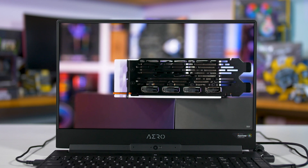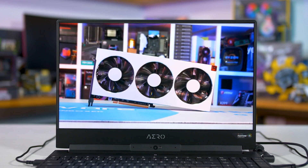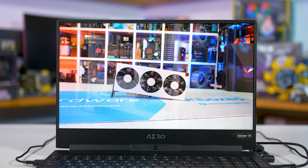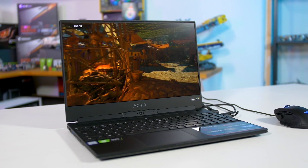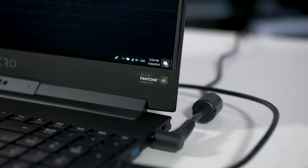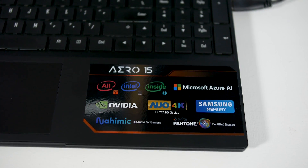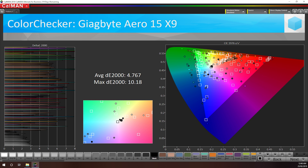My Aero 15 X9 review unit came with the 4K 60Hz IPS display option rather than the 144Hz 1080p option I reviewed in the older model. The 4K option is the route you'd take if you want to use this laptop for creative workloads or content creation, as really 4K is too intensive for the RTX 2070 Max-Q for gaming. Gamers would be better off with the high-refresh 1080p screen, especially as the GPU can handle many games around the 100 FPS mark on ultra settings at that resolution. While this display is supposedly X-Rite Pantone certified, unfortunately I have a few issues with the 4K panel and its calibration. This is a wide gamut monitor targeting 100% Adobe RGB, and it comes with what is supposed to be factory calibration through an installed profile. However, the profile has been generated incorrectly — it looks like Gigabyte has mapped the display's wide color primaries as the sRGB color primaries, which leads to oversaturation and other weird behavior. I noticed this oversaturation straight away; everything is extremely vibrant on this panel.